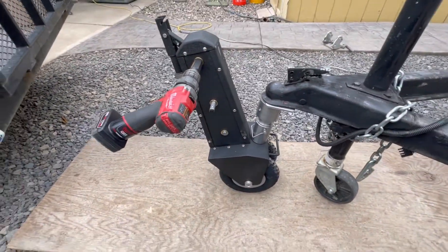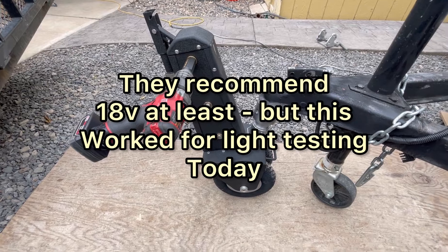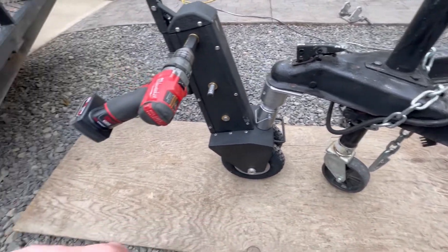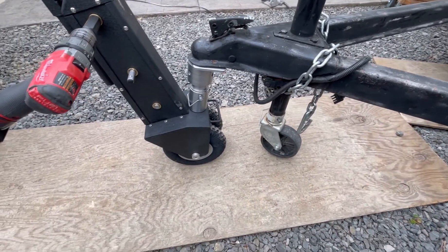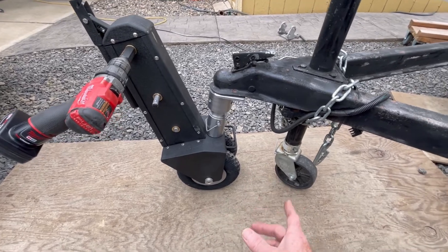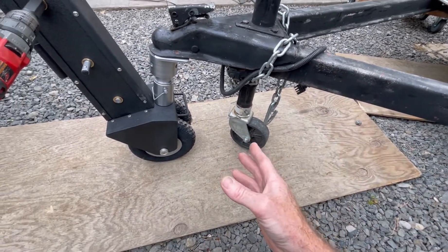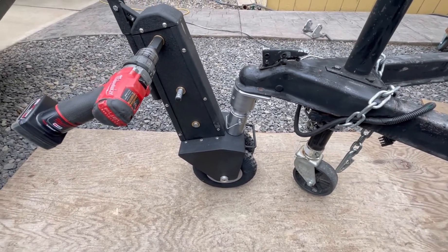Since we're lightweight today I just grabbed my 12-volt Milwaukee drill — I'm a fan of Milwaukee if you've seen my channel. I need to move this trailer back and forth once in a while to make room for the other two trailers. I tried it on gravel and it doesn't work at all — the tires just spin and dig in. So if you've got gravel, this is not for you unless you use some plywood. Even on plywood it's sketchy; it actually started spinning, and you kind of have to push down on the tongue to get any traction.